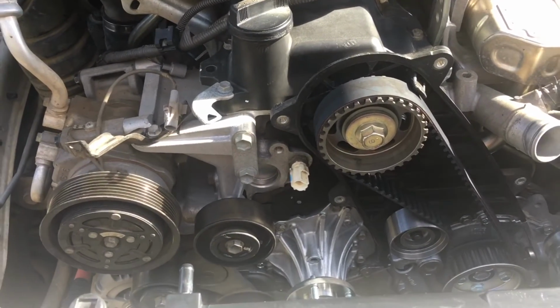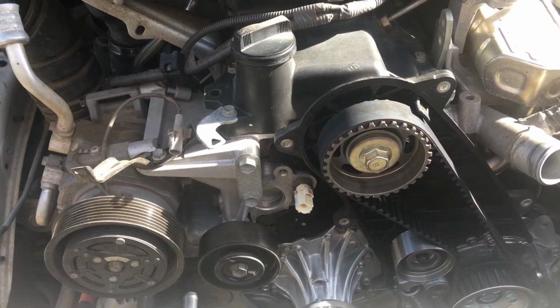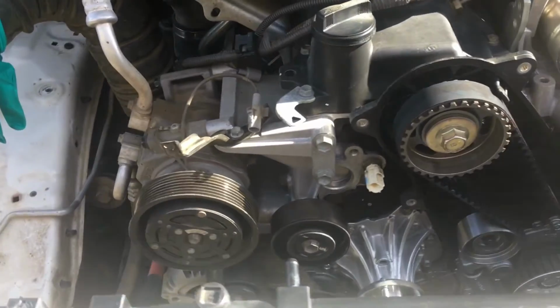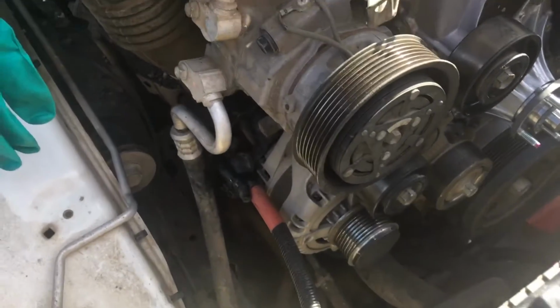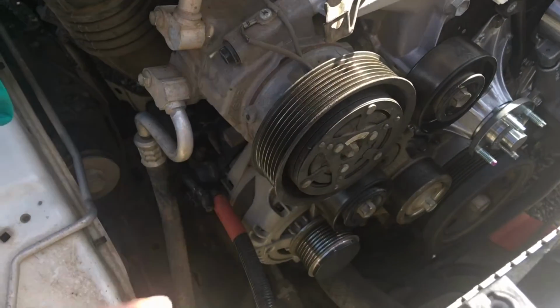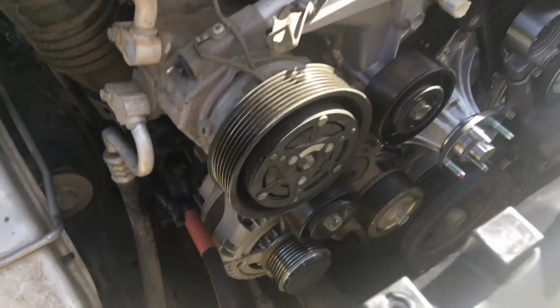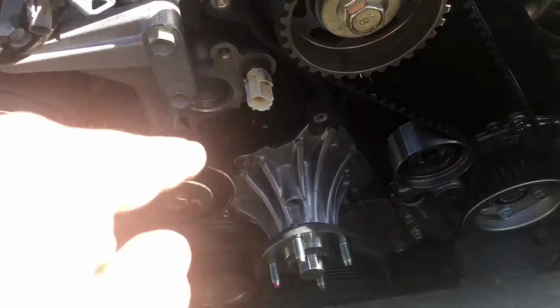going to go through it again. I've mentioned it in other videos. We've got a playlist, I'm pretty sure it's called the BFE job, BFE information, that sort of thing. And you need to remove the compressor, it comes off back here, the alternator, disconnect your battery, disconnect your wires, remove the alternator back here, because all that goes over the top of the bracket of the back of the water pump.